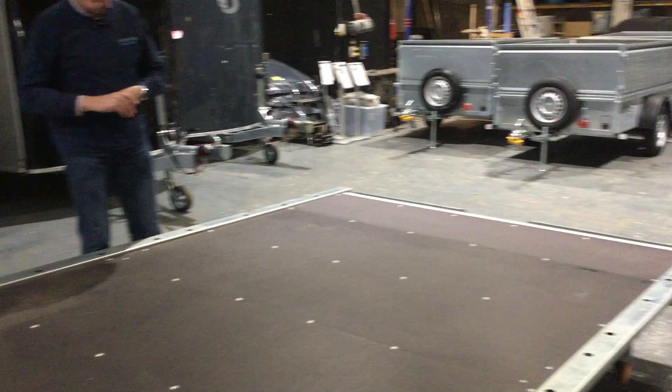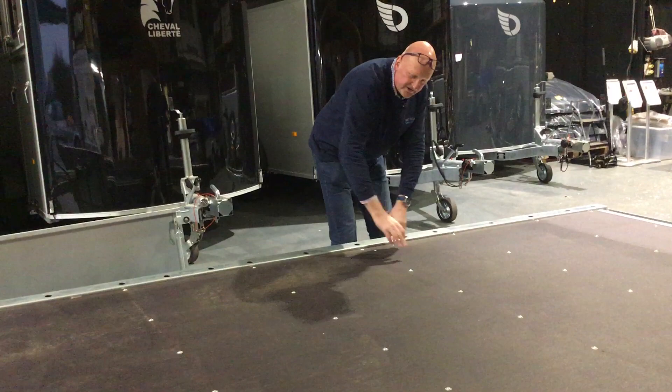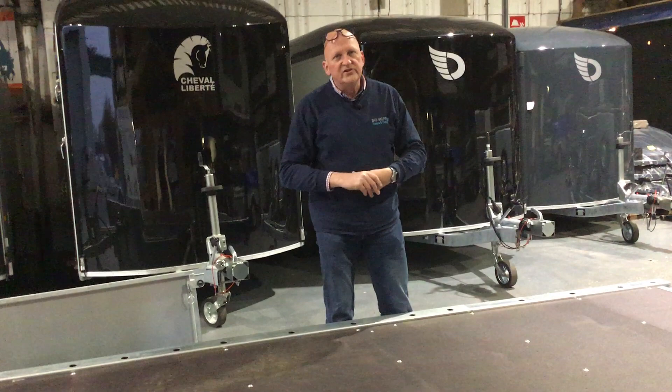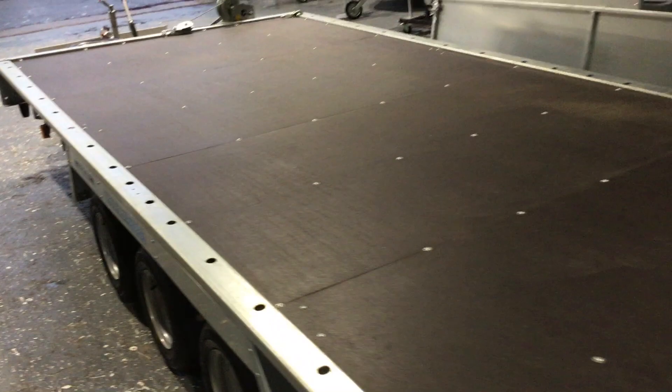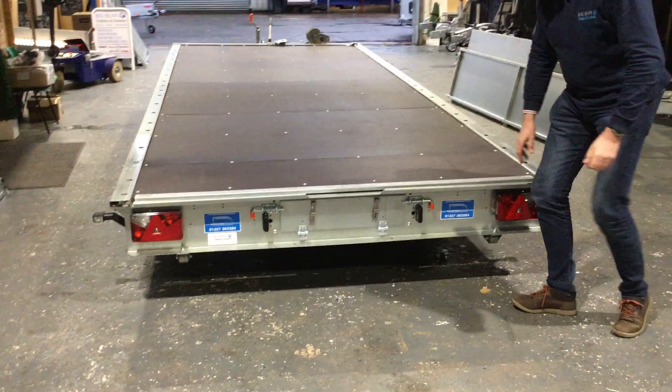You've got tie-down points all the way down the edge on each side. There is an option currently being developed — which historically has been available but quite expensive — to have a punch deck floor about 30 to 40 centimetres wide. So if you were moving cars on a regular basis, you can do the over-tyre straps. That's currently quite an expensive option, but coming soon is a more cost-effective version. Off the top of my head, I think it's going to be around £600 plus VAT, and that turns this from a pure flatbed into much more of an all-round general-purpose trailer.